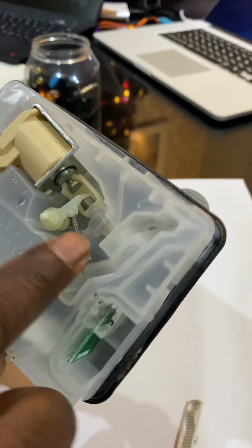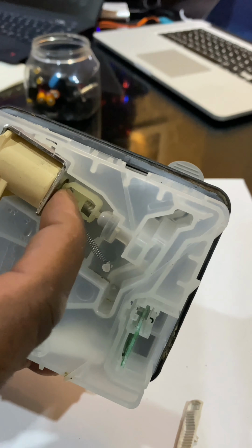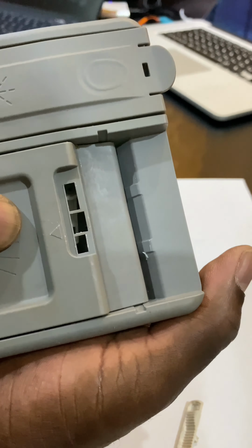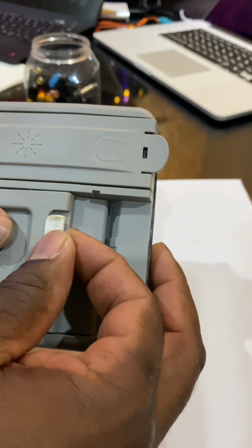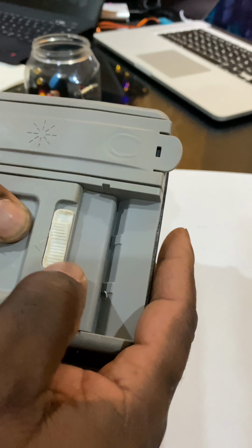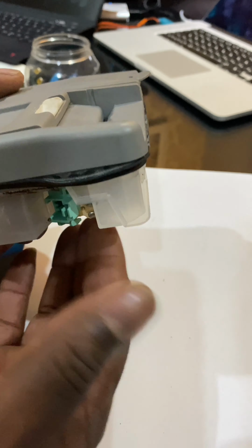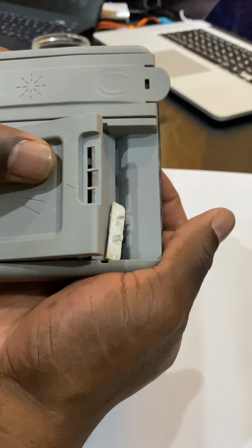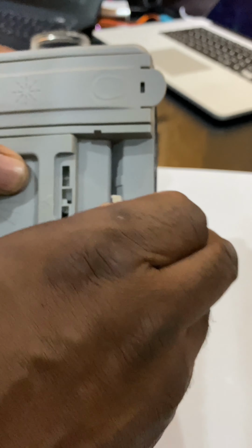To show you the back, there's a solenoid here which triggers the lid for the soap tray. And you can see the action there which releases it if the button was in place. And I'll just pop the button in just to show you. When you pop the button in and lock it, and I'll just press the relay at the back there, you see it open. So it releases.